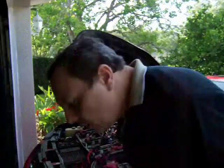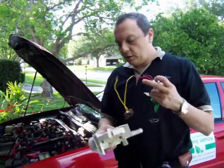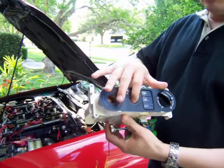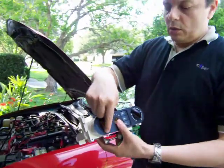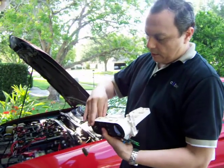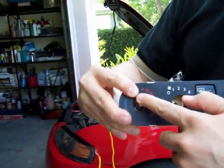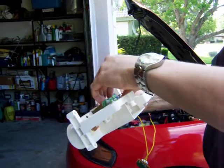I'm very happy with the results of the air conditioning. What I did is I connected the buttons of the air conditioning pretty much like the original car. I had to get another controller like this because this was severely damaged — the buttons were broken. So I got a new one and it works really good. This is the temperature control, and what I did is I removed the mechanical part and I connected a potentiometer. It turns out that this fits very well in this place — I tied it to this and then I just put the knob, and it worked really well. This is the module that goes in here.